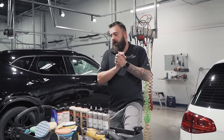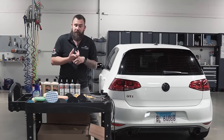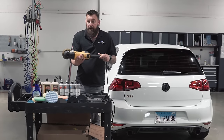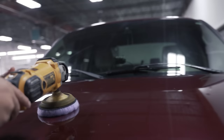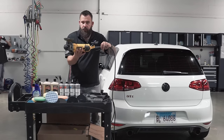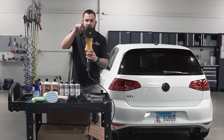We're going to start with different machines. There are a variety: rotary polishers, forced rotation polishers, DA polishers — short throw and long throw — and different sizes for all of them. The first type is this rotary high-speed polisher. I don't use it anymore with the innovations in the detailing industry, but there are certain situations where it comes in handy. It's a hard machine to master. It just spins in one direction — it doesn't oscillate at all.